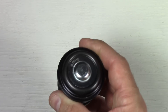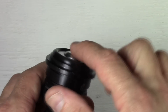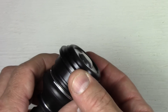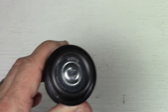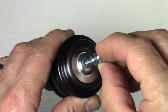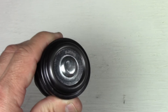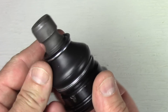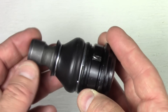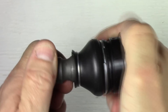Also, if you look on the bottom, you can see right there — it has a dimple on the bottom, basically a bump that allows you to drill it out and put a Zerk fitting on there like so. And that's what I'm going to do. The reason for doing that is I want to be able to lubricate the actual ball joint without taking it off the car once I install it.